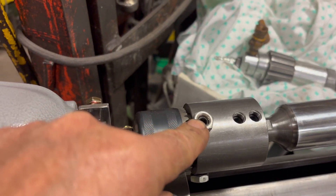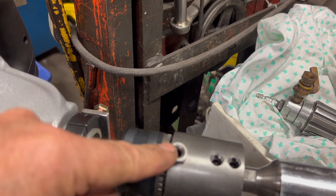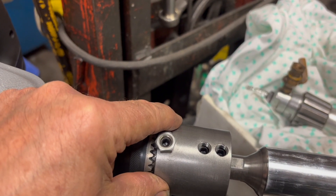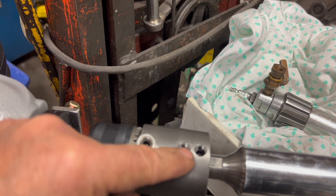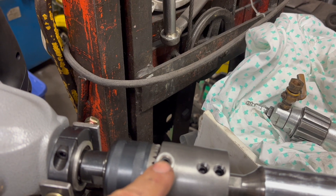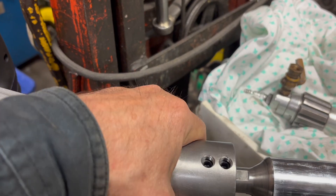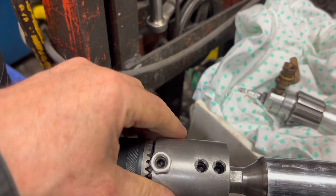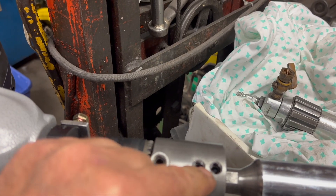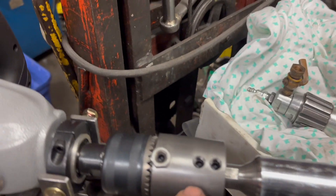This is the other screw which you attach — the adapting coupling. This coupling goes from the three-quarter to the chuck. Those three of them. Don't tighten them too much. Keep them a little bit off, even to play a little bit — that does not matter. Then you lock those set screws on the shaft to hold it.